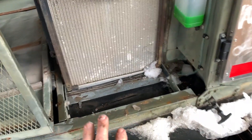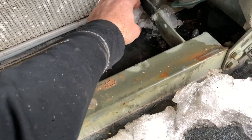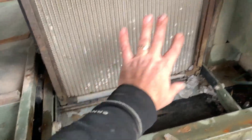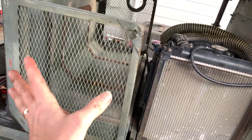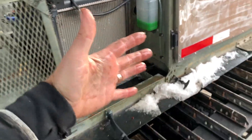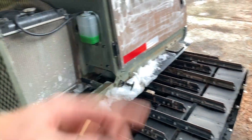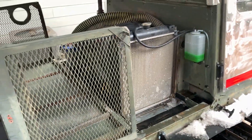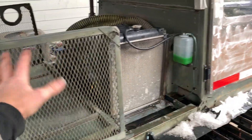There's a block of ice built up here — I think there may be damage from ice too. This area is open, and the fan from the motor draws air in, sucking up all the snow kicked up by the tracks. I'll need to figure out some kind of solution here to prevent snow ingestion.